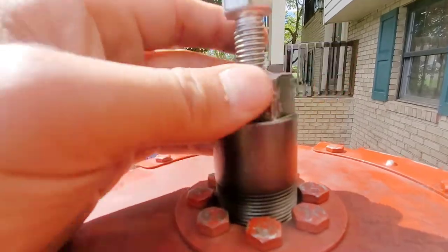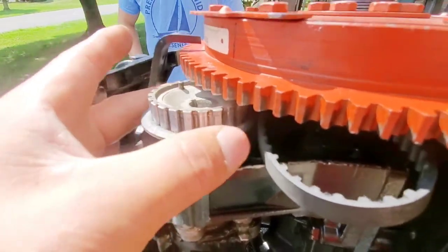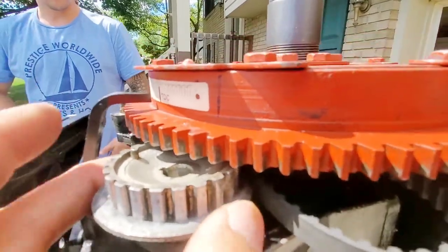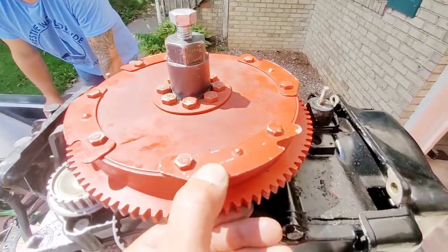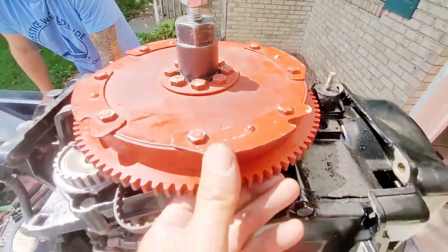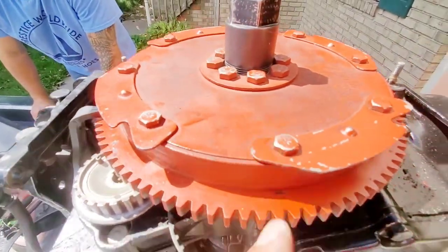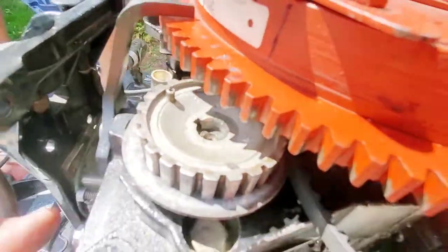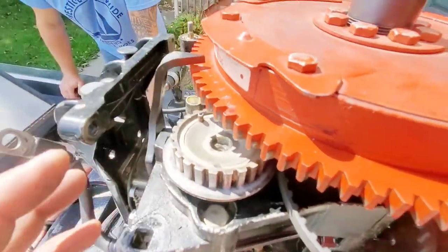I'm going to screw this in and gently lift the flywheel just enough space so I can pull this pulley up. See how it's hitting the flywheel right there? I just need to pull that up so I can reach the bolts here and drop it. I cheated and used an impact wrench to loosen this. I also realize the bolt is under here, so we're going to have to completely remove this and then cycle the belt back on without destroying it. We're going to remove the timing cover, loosen all these bolts, and once we get the flywheel off, we can loosen the three bolts — one in the back — and drop the distributor efficiently.